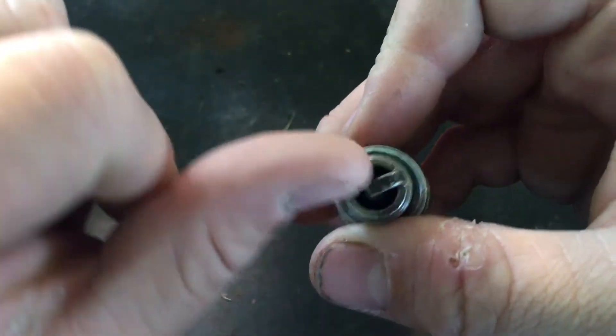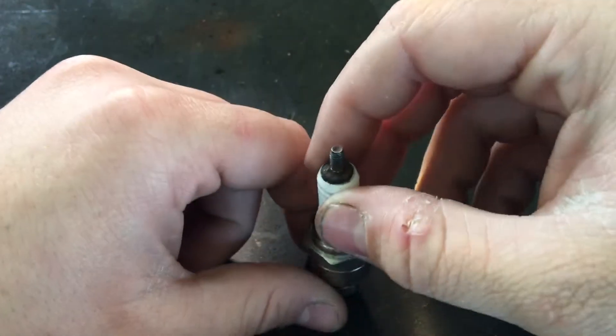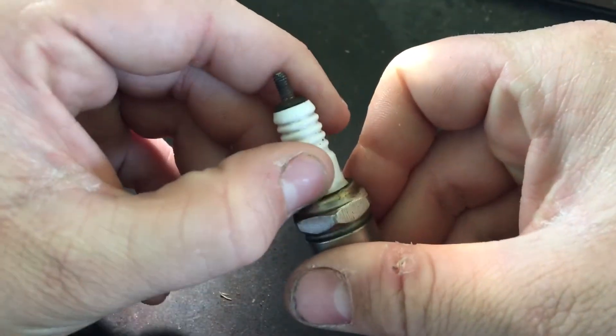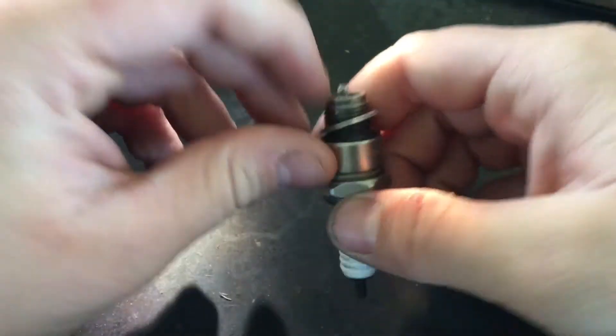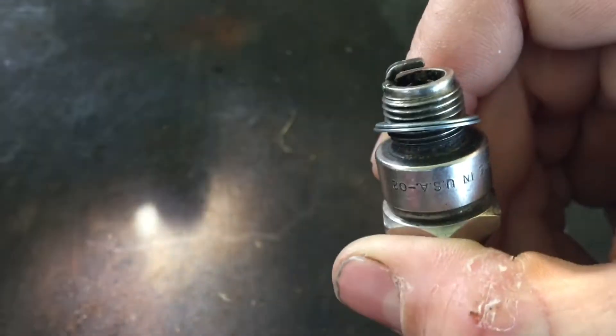In the middle is a mid-range plug. Obviously you have to run a plug for a while to figure that out, but if you look at the specs of the plug it should say. This one — the 93 — is probably a cold plug, because you can see where it's burning is back here.